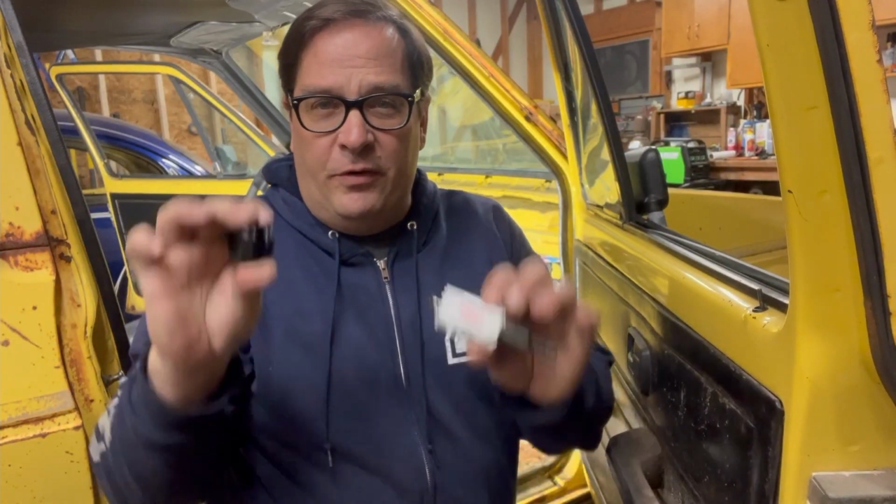Well, guys, that wasn't too bad. Made it to the hardware store and the auto parts store. Got some firewall grommets, got a hole saw for the firewall grommets. It's getting pretty cold out there, so there ain't a lot of people around, so it was a quick little run. I think that was the right decision. I'm gonna pop these holes in there, run these cables through them, put these little grommets in there, and see if we can't get some stuff connected up.